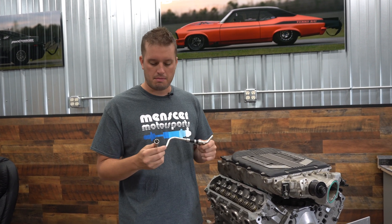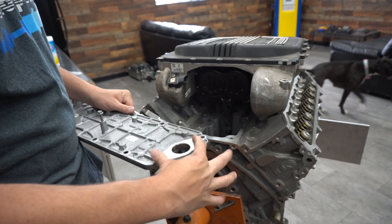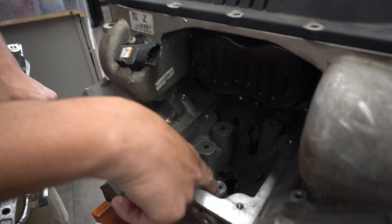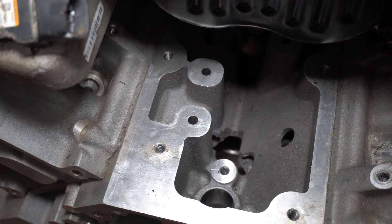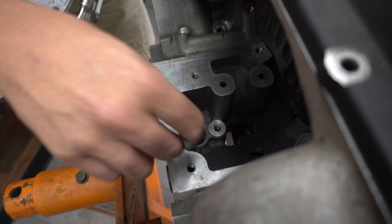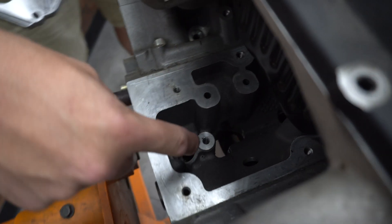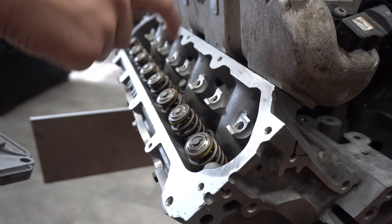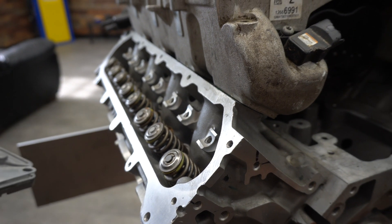With that being said, the factory puts this handy-dandy hard/flex line on the engine. The mechanical pump sits right here, and if you look down in here, there's actually a bore — it looks like an oversized lifter bore — and it's driven off the camshaft. They need to get that fuel line connection out to the side so they can run it to the back of the car, because you don't want to have to take the intake on and off to disconnect the fuel line.